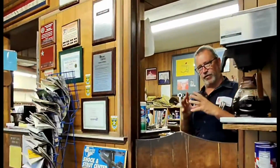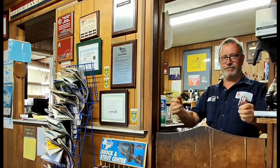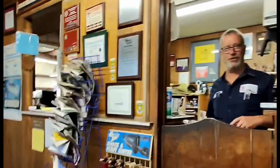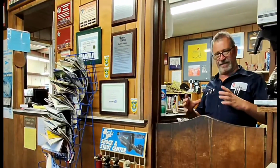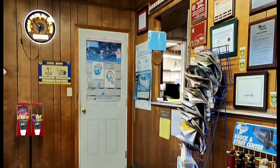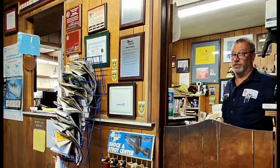You're bringing it down to the lowest spot of the tire and making that tire perfectly round, then you balance it. A lot of times you get a vibration. People say, well, just balance the tires. You balance the tire, but if it's out of round, it's still gonna vibrate. It's kind of like balancing a football. You roll it, no matter what you do, it's never gonna roll right. But when you make that thing perfectly round and then balance it, all the difference in the world. It can get up there in price because some of that stuff gets expensive. Because you're cutting the tire, right?